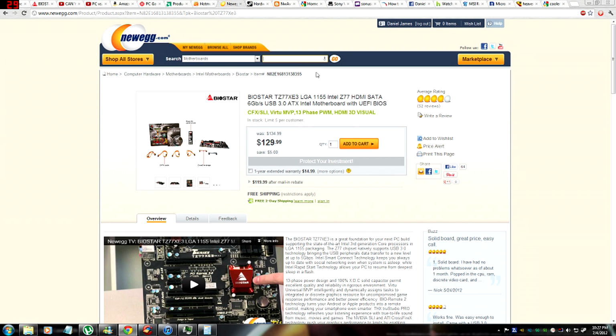The graphics card I got was the HD 7850. It's a very, very good mid to high range graphics card. If you want a better gaming performer than mine, for pretty much the same price that I built my computer, you can get a lower end CPU. As a result, you're going to have more money left over to put toward the graphics card and get a higher end graphics card. An i3 processor won't really bottleneck the higher end graphics cards if they're running by themselves. It's not until you crossfire them that the i3 may start to show some significant frame rate droppage as opposed to a more capable CPU.